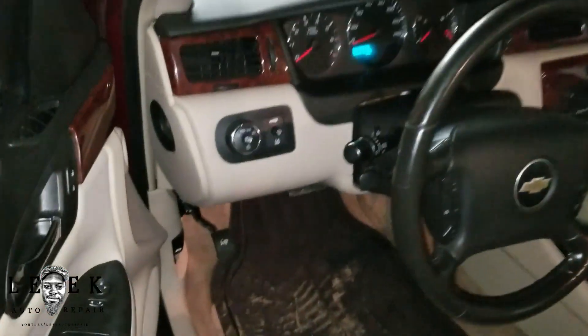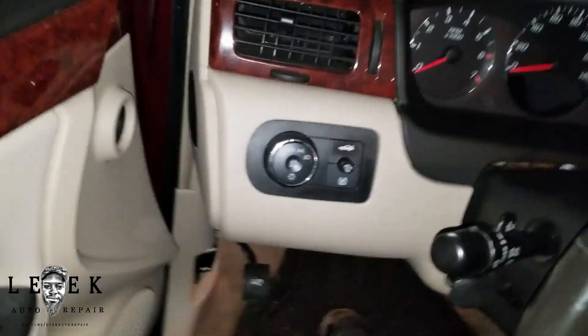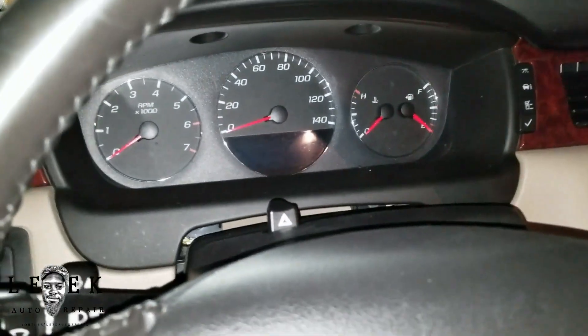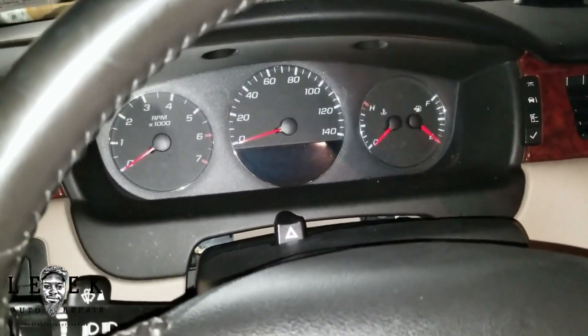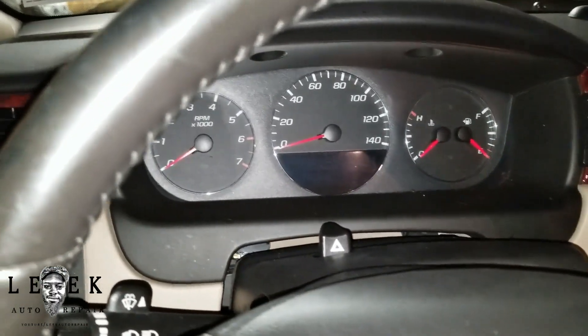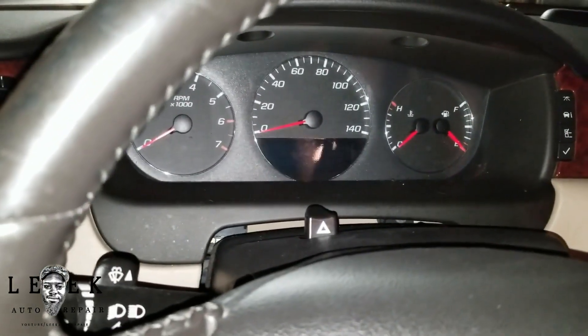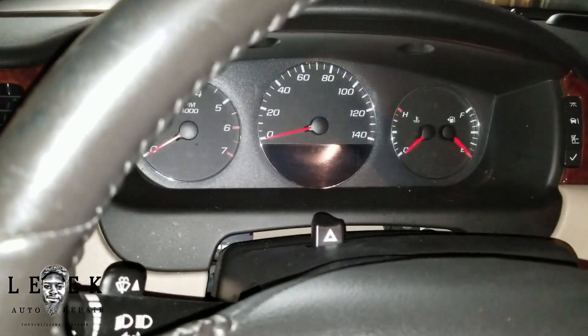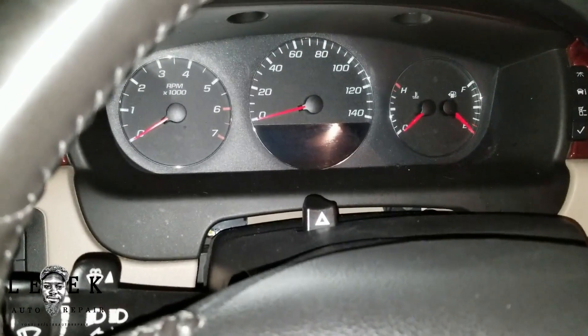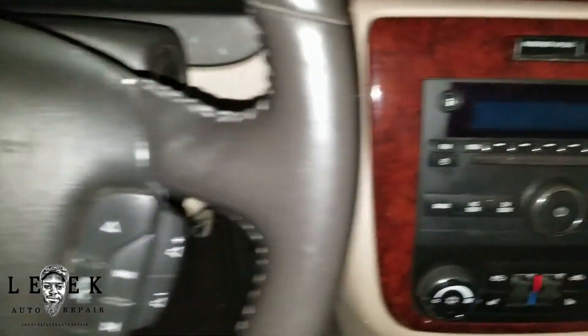Before you install, make sure you relearn them back to wherever the wheels are, then go over each wheel to see which ones are out. If one doesn't read, you'll know how many you need to replace. I replaced the one that was necessary — it was in the wrong spot. Check them first, replace the bad ones, and then when you're ready, go through the relearn process.